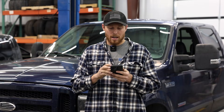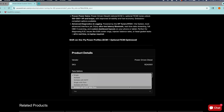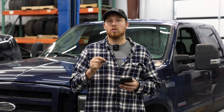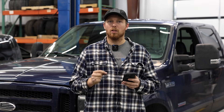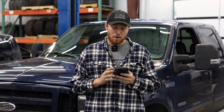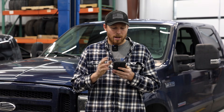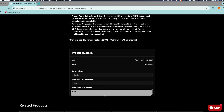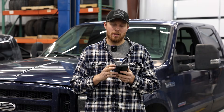The other option is with FICM tuning or without. Standard multiple or non-FICM tuning lets you tune the ECM, which gives you a lot of capability. But FICM tuning — fuel injection control module tuning — really helps unlock more fuel and more power capability if that's something you're shooting for. I would definitely recommend multiple shift on the fly with FICM; it gives a lot more control and more things we can adjust. Obviously that's going to be the most expensive as well. And then we have aftermarket turbocharger yes or no, aftermarket fuel system yes or no — just fill in what you've got so we know what you have and can write the best tune for you.